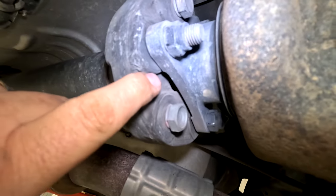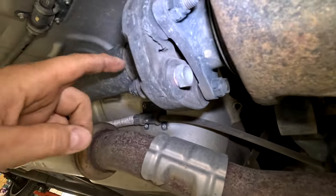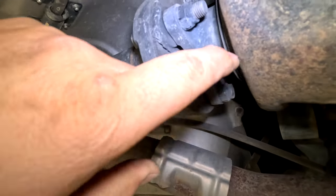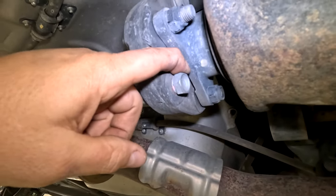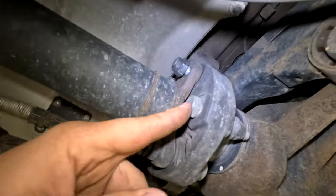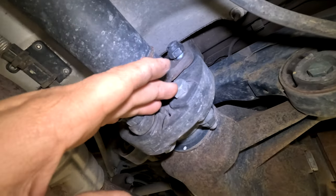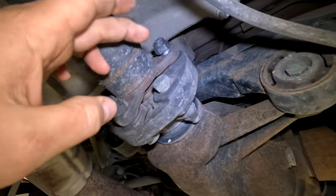Here's the damage — you can see it's ripping right now, that's why we're changing these. At the rear, same as the front: the indents are righty-loosey, lefty-tighty — reverse thread. The straight ones are normal thread. Make sure the way you take them out is the same exact way you put them in.